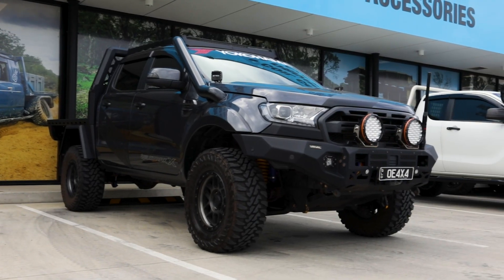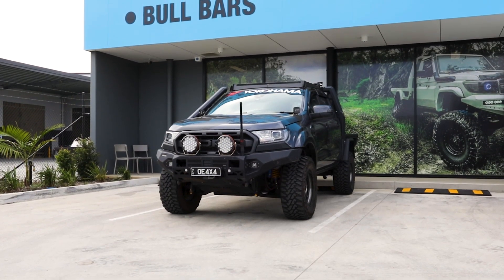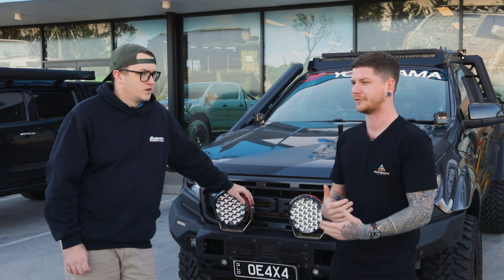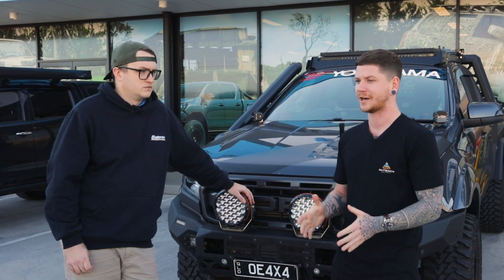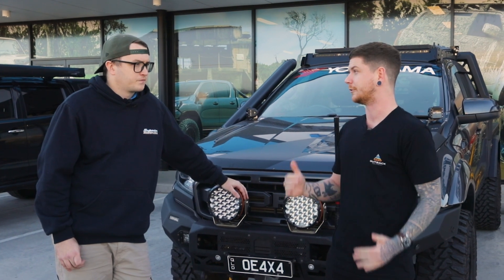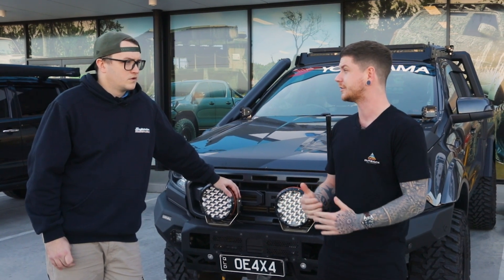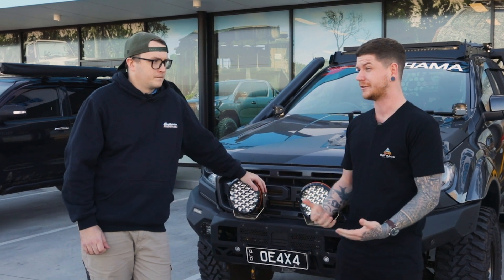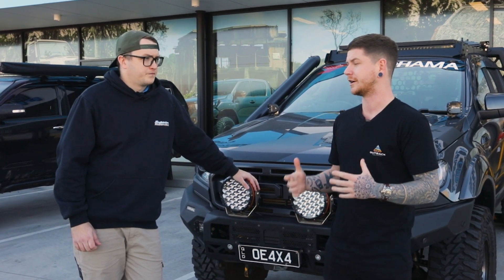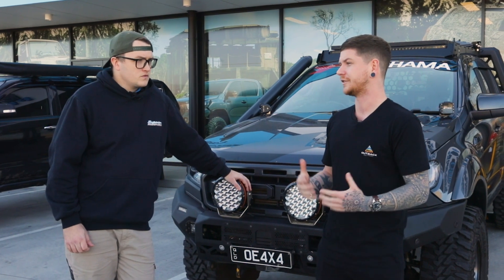What's the reason why you're wanting that coil conversion? The main reason I wanted it is comfort of the ride. With the leaf springs in the back, it was obviously a bit stiff, not very comfortable. So I'm chasing that comfort, but I don't want to sacrifice my off-road ability as well. I'm really keen to get a bit more flex out of the back, put some longer shocks into it, save a bit of weight because the leaves are so heavy, and also be able to put the canopy on and go touring if I need to with a simple setup.